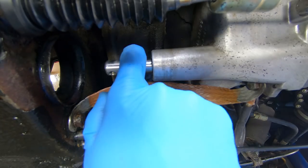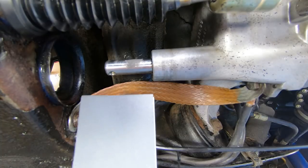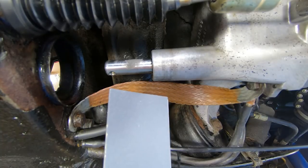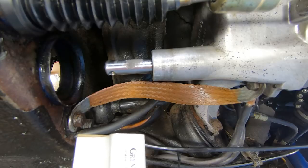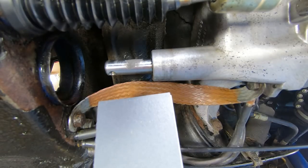It's the next morning and our epoxy has set, so let's take a look at it and see what we need to do to shape it. Now it looks really good here. It's actually pretty close. Did amazingly well. I have our 320 grit sandpaper here on an actual sanding block so that we get a nice flat, even sand on our first go round here.